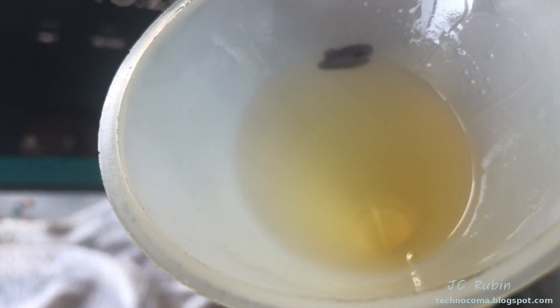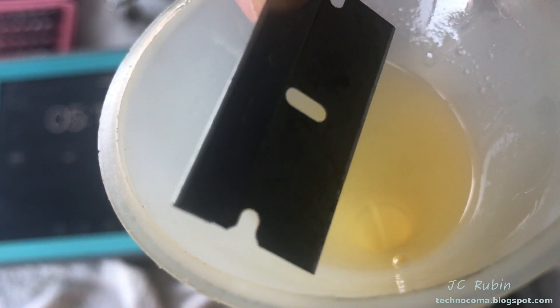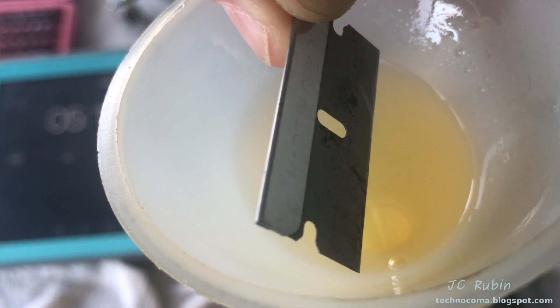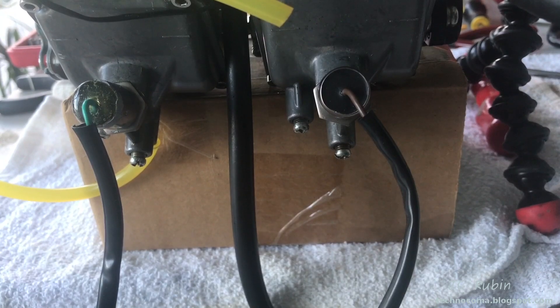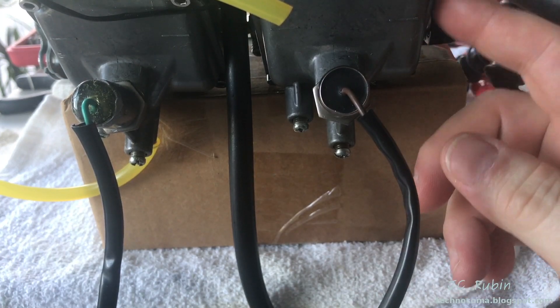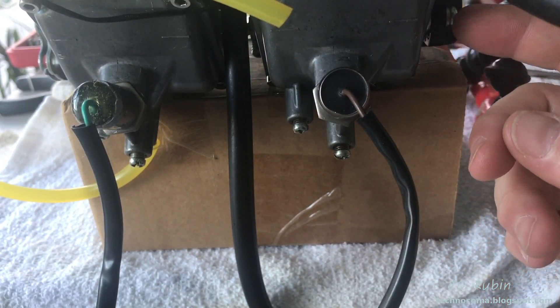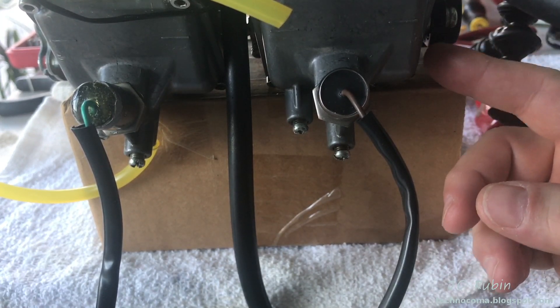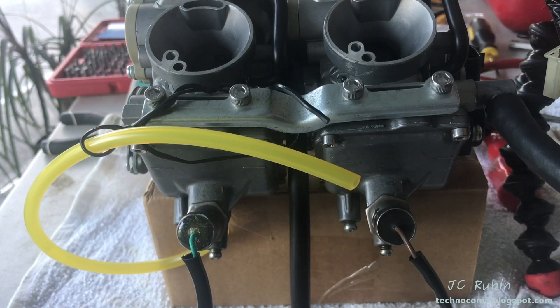After five minutes, if it is dropping, it's dropping an infinitesimal amount. This funnel is really small — here's a razor blade for comparison, a tiny funnel — and this is all the way down at the bottom. So a very small amount could evaporate off, or a little bit could be leaking very slowly, but there's not really a leak here. Looking under the carb after over five minutes shows no gas on the cardboard, no weeping from any of the seals on the side of the bowl covers — essentially no leaks.